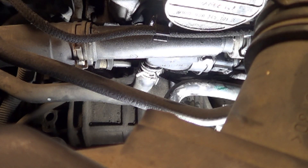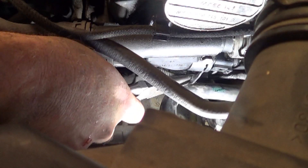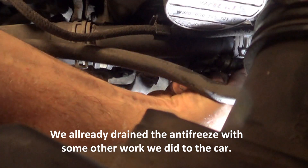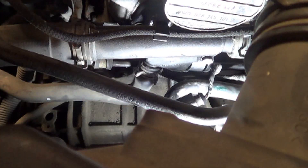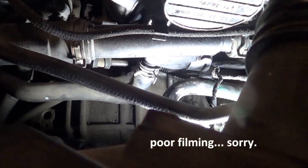Here on the back of the head is the temperature sensor, right below the vacuum pump. Not very easy to see, but changing it is super easy — you pull this clip out, then pull the sensor out, make sure the O-ring comes out with it. These Volkswagen connectors are difficult to unplug, but you can hook them down here and unplug them much easier usually.